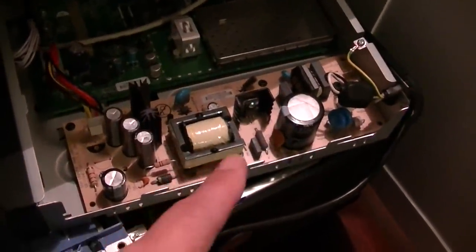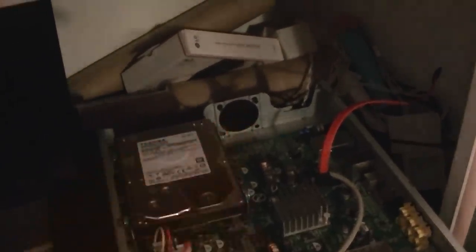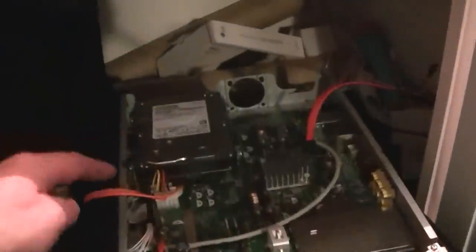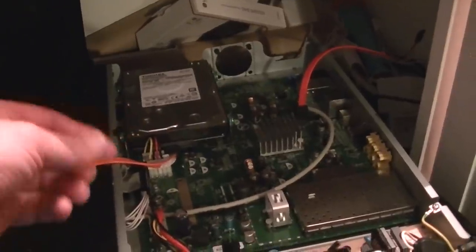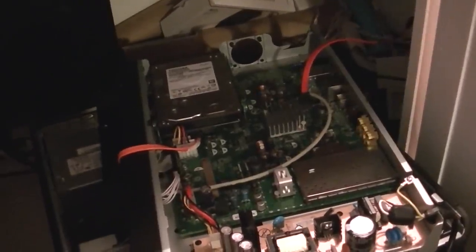Here's the machine — you can see the power board is still intact on this second machine, and here's the hard drive. I've actually removed the fan because I'm going to strip these for parts. What you see here is the SATA hookup going down to my other machine, whose monitor is up here — this is what I use for everyday TV viewing. I'm using this to power up the disk, then unplug it from the SATA cable internally and hook it up to this SATA cable.